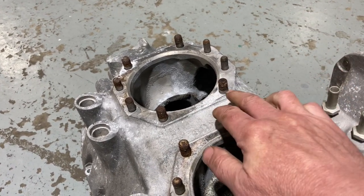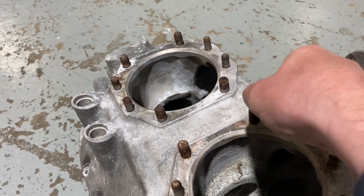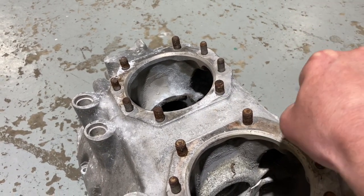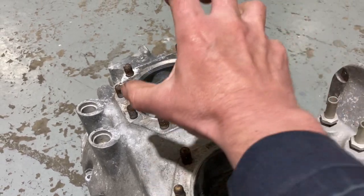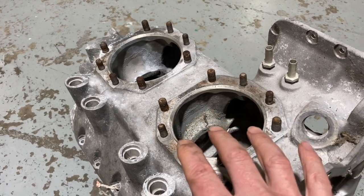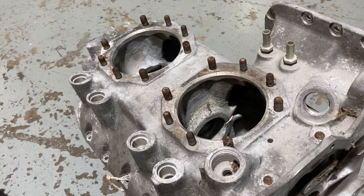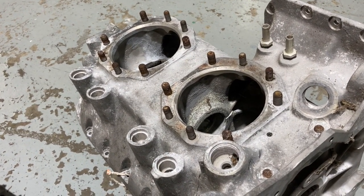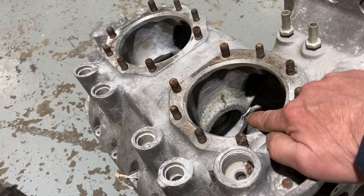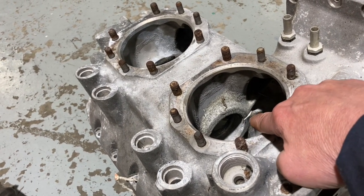The torquing procedure is a wet torque, and the last bit ideally should be done in one smooth movement so you don't get static friction building up causing it not to move. You go to the initial figure first and then your last figure in a nice smooth movement. They're awkward to get around and you can get a false torque. There are a few things that can go wrong on an older Lycoming engine — it just needs careful attention and good standard practices, but it doesn't always get done.